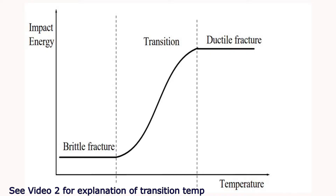If the failed axle didn't have any welded attachments, we have to assume that there was probably a casting defect inside, and that's a bit of a worry because the crack would have been largely undetectable. However, the saving grace is that at the temperatures encountered on the Canning Stock Route, the steel is well above the transition temperature and it's very tough, meaning that the critical crack size at the point of failure is going to be quite significant. From the point that the crack goes through thickness, we are going to get an oil leak — initially just seepage but it will then develop into droplets of oil on the ground. Providing regular underbody inspections are performed, there's every chance to detect the leak, and I would emphasize that any unexplained oil leaks need to be thoroughly investigated.